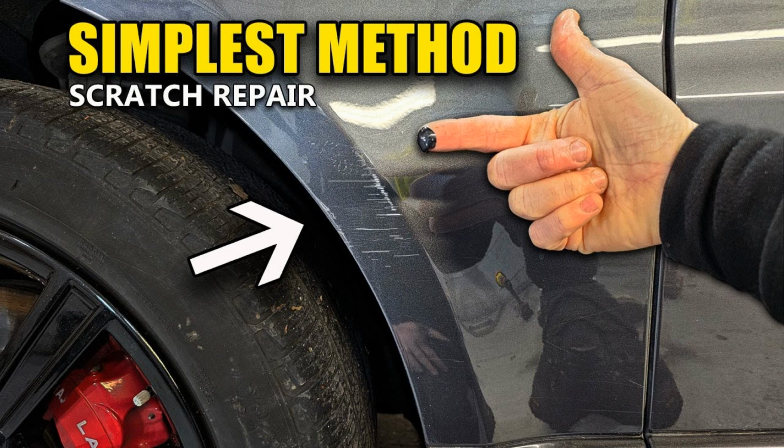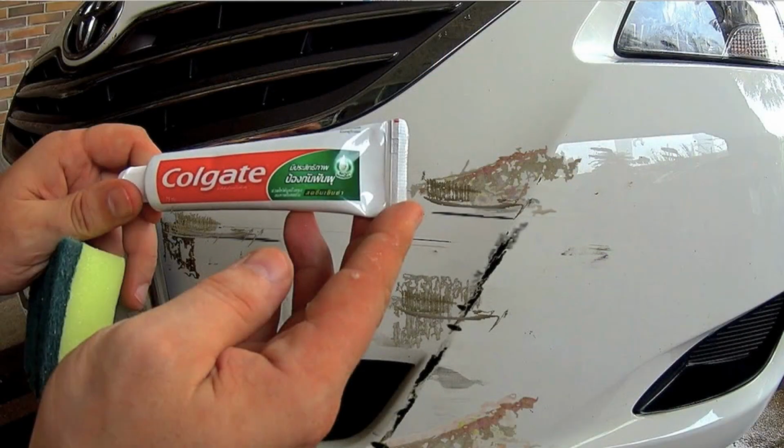7. Create V-shaped grooves. There are 2 ways to approach this. If your bumper is the type that powders when sanded, cut the grooves using a 24 grit disc on a sander. Use a cordless drill and rotary file if your plastic bumper is of the smearing type. Run the tool along the front and back of the fascia, forming a V groove on each side. This will make it easier to align the edges while providing more space for the filler material.